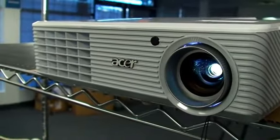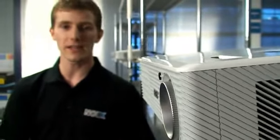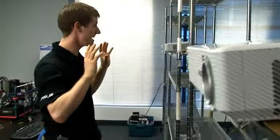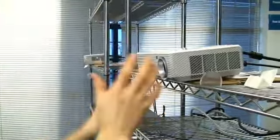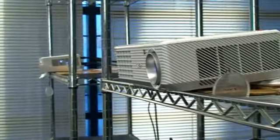We are using three 720p Acer 3D Ready DLP projectors running at full 120Hz off their HDMI input, off our GTX 590 graphics card. I've got them pretty ghetto mounted here, because getting the alignments just right to achieve one continuous image required some careful adjustment — even one extra piece of paper under one projector — using metal racks since I didn't have proper mounting options.